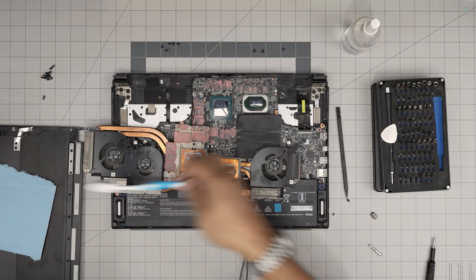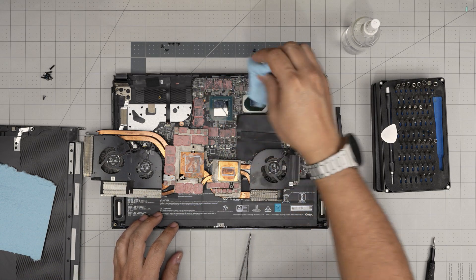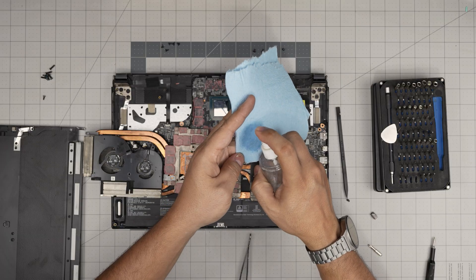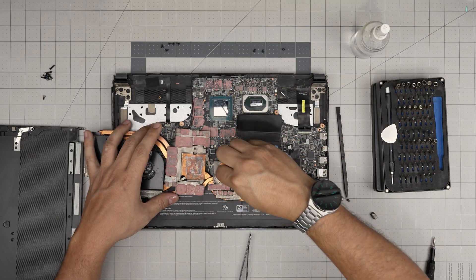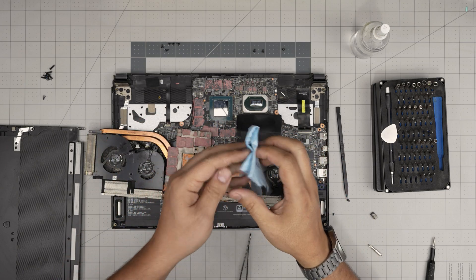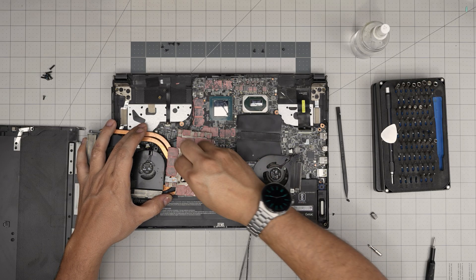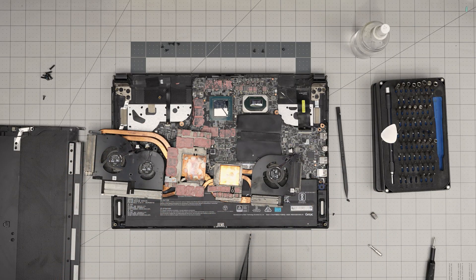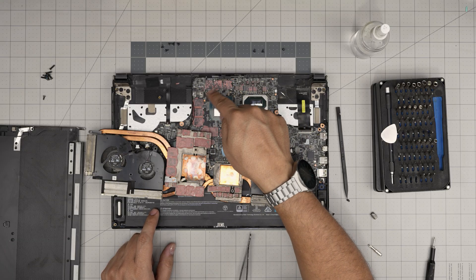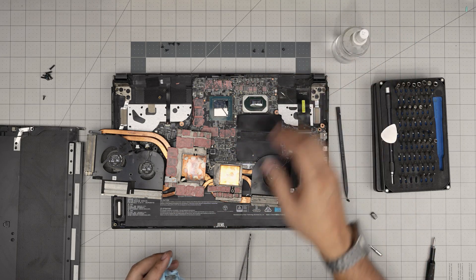Use a toothbrush to clean further, then use a dry part of the towel for a second pass. Make sure there are no dust particles on the die. Grab a second piece of towel, soak it in alcohol, and wipe over the heatsink in a circular motion — nice and clean. Do a second pass. If you want, you can do the same on the VRAM area. You don't have to clean the VRAMs with alcohol — you can just put fresh thermal putty over them. But if you do clean, use 99% or 98% isopropyl alcohol.